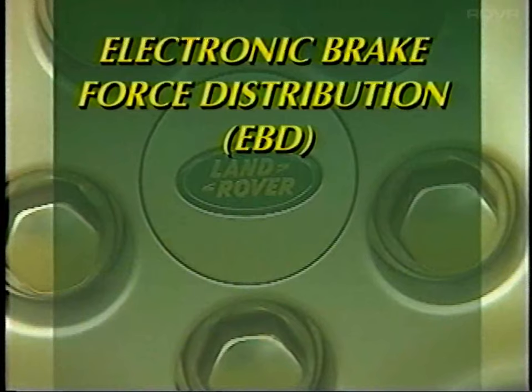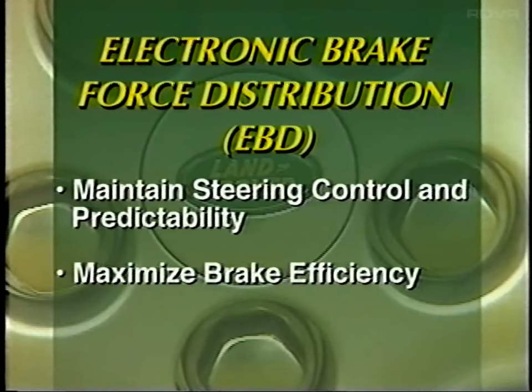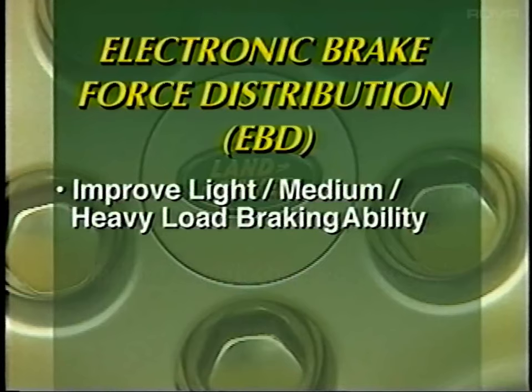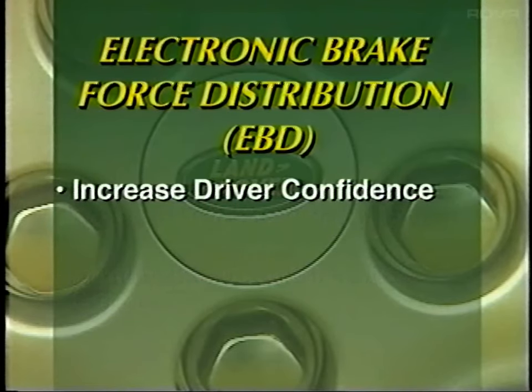Working without driver input, EBD helps to maintain steering control and handling predictability, provide maximum braking efficiency under all conditions, improve light, medium, and heavy load braking ability, eliminate premature operation of ABS, and increase driver confidence.